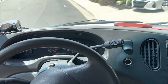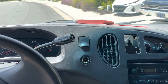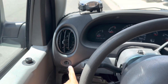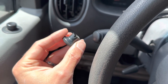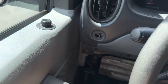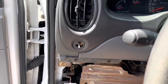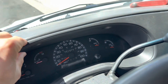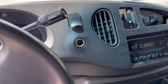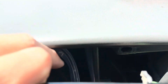All right, we're in the van. We're going to have to remove the radio bezel, which as you can see it's already done, but I'll show you what you need to do in order to get it all the way off. You got two screws - one here, one there. You got to remove the light switch. There's a little press clip toward the face of the light switch, so you stick a little screwdriver in that hole, push it forward, and you should be able to pull this thing off. Then kind of like a bezel, you just unscrew that counterclockwise and that comes off. Then you can start prying out the clips - start on this side, pop them all the way off, comes all the way around the edge. You can take out the radio. I left it in while I pulled it out, then reached under and undid the clips. I accidentally broke the clip on the back of the cigarette lighter, so be careful with that.